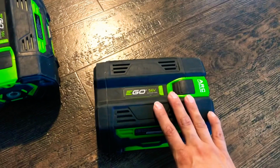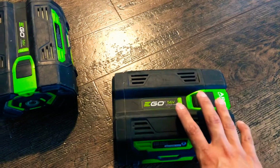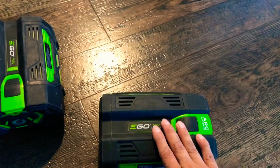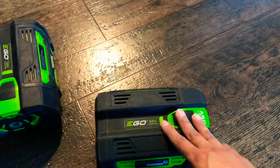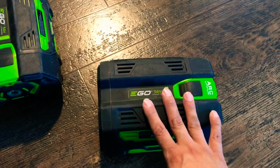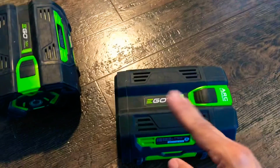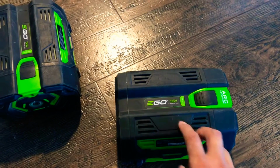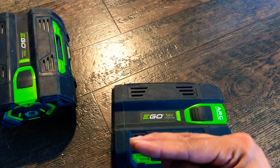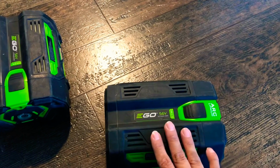Also try not to drain them past their first shut off. Most lawnmowers will automatically shut off once the battery is depleted. So don't try to restart the mower to get a few more square feet of grass cut. Once it shuts down, just take the battery back to the charger and let it charge. If you keep running it till it depletes all the way down, guys, one or two of the cells inside the big battery can drop its voltage so much that when you throw it on the charger, it won't charge up anymore. So yeah, don't do that.